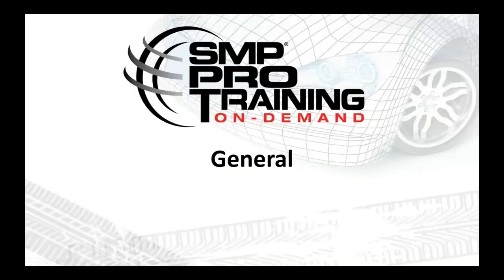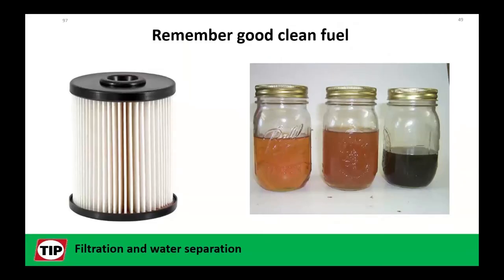Just some general stuff over here. What's your fuel look like? Now use a good quality fuel filter. That filter is designed to shed water. A lot of your cheaper ones do not shed water.